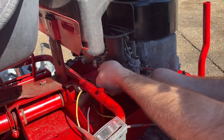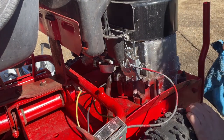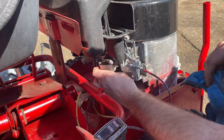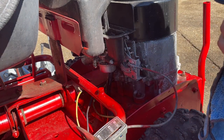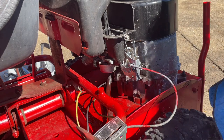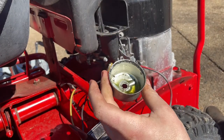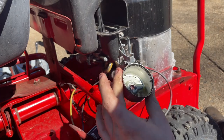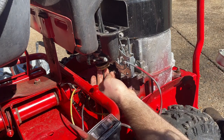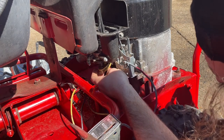Getting this old bowl drain off - these are usually half inch, or 13mm for us metric folks. I'll fully expect to smell like gas for the next week. Here's our old bowl drain. Let's see what we get here - this came out pretty easy, which usually means it's not too bad inside. No wait - take a look in there - that wasn't gonna run. That's water. A little crap in there too.